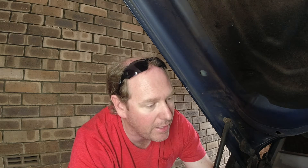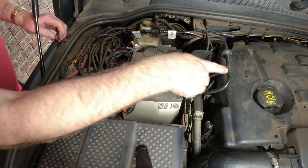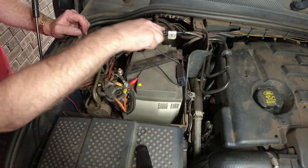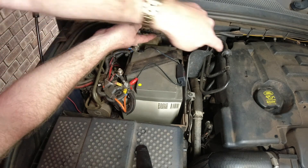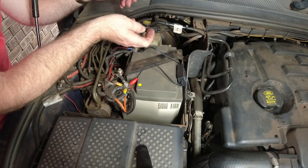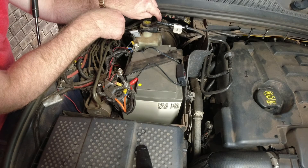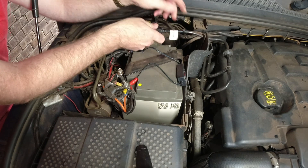I'm going to check what's going on and go from there, then make a parts order. The vacuum line runs down to the vacuum pump at the back of the engine here, runs across here, quick connects here, there's one down here. It's still holding plenty of vacuum, but yeah, that's wet with oil. Because this involves the brakes, I'm just going to assume I'm getting oil into the booster and replace that.